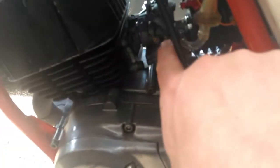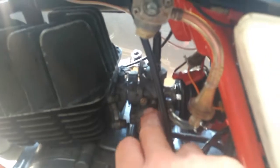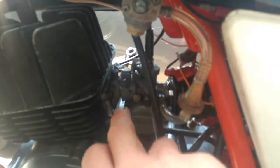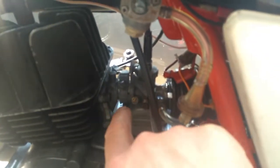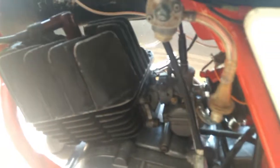I had it running for about 45 minutes until I think I ran out of petrol. I played with the idle screw and the pilot jet just a little bit. I actually made the mixture more lean by bringing it out a bit rather than more rich by screwing it in. I got the idle set up with the lights on, which was quite important — I wouldn't want to put the lights on at night and have it conk out.